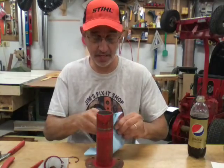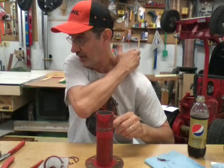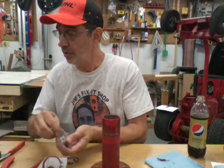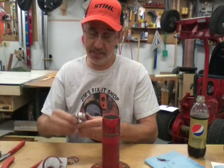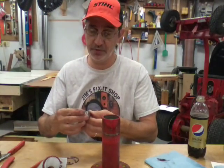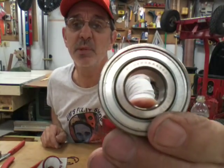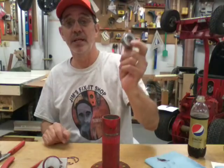I've had a lot of comments from viewers on how to buy bearings. I've been buying bearings for years. What you want to do when you take a bearing out - I buy Timken bearings. There is a number on the bearing - you can see it there on the camera - so you use that number to order the correct replacement.